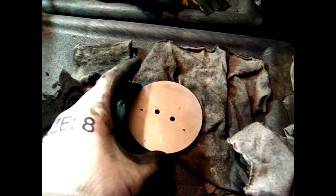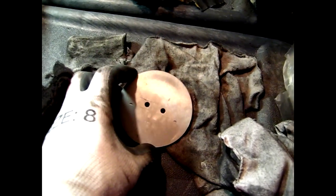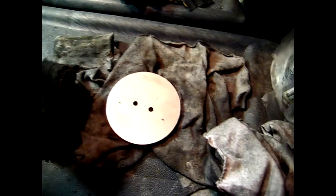You can see the butterfly has somewhat of a rough finish — it isn't a fully polished surface. But compared to the inside of the throttle body, it still has a fairly smooth finish without really bad porous spots. So instead of using sandpaper we are going to skip right to the Scotch-Brite stage and give it a good rub down, the same as we did inside the throttle body. We can also use water for this. You can see the tone starts changing and it begins to take on more of a mirror finish. Once we have gone over the whole flapper and we are satisfied, we can move on to the polishing stage exactly as we used for the bore of the throttle body.